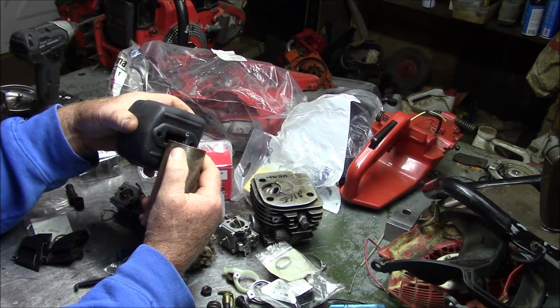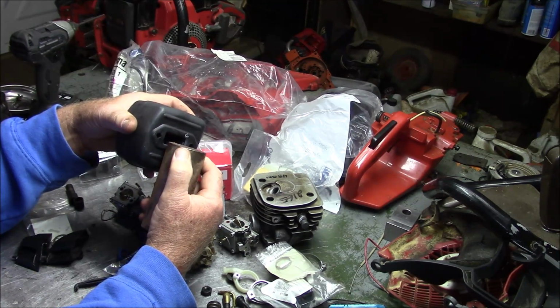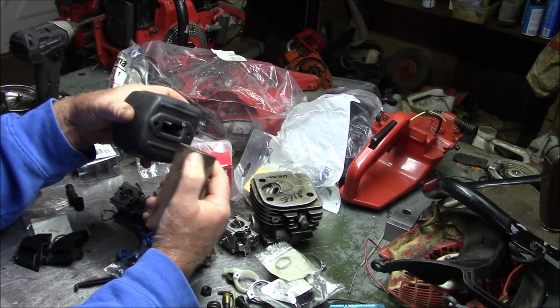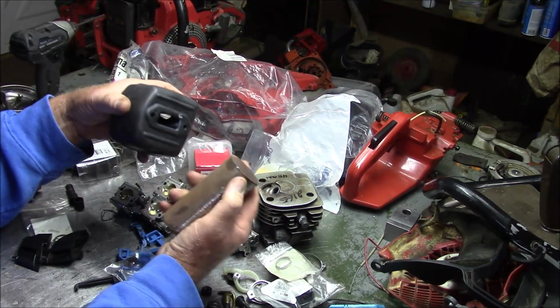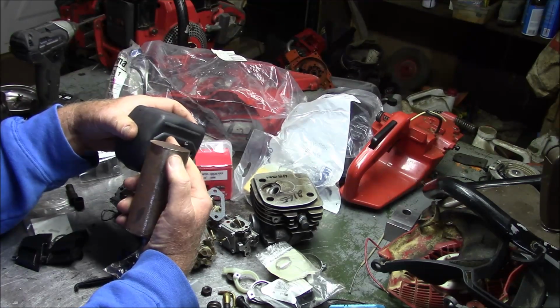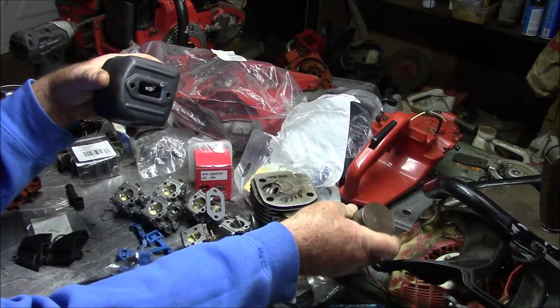When you take a pop-up, what you've done is you've machined the top of the piston just a little bit, so you're actually maybe cutting that interference in half, if not more, depending on how much you dropped your cylinder. Which means you don't have to do as much work on the top edge of the transfer in order to get that cross-sectional area back.